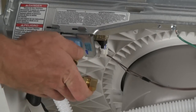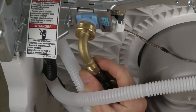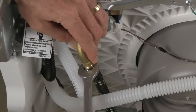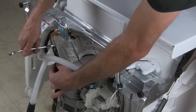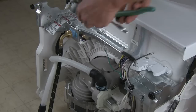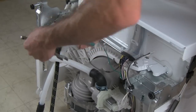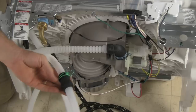The female style has recently been adopted by Whirlpool and uses a very familiar hose connection. Use caution — if you cross-thread this plastic valve, you will need to replace the dishwasher's water valve. If you're using a new water line, you can connect it now while everything is easily accessible. If you are reusing an old water line, do your best to get the elbow lined up at the proper angle to meet up with your water connection as you reinstall the dishwasher. Some dishwashers require that you attach a new drain hose now as well.